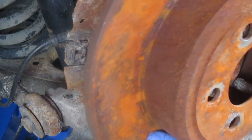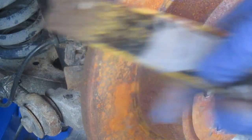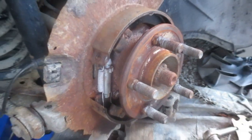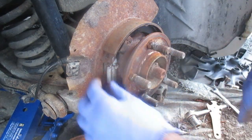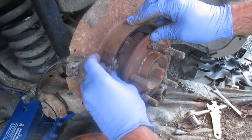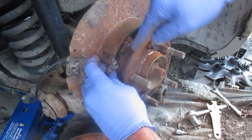What I had to do with this car is the previous owner had left the emergency brake on and those pads were right into it — I really couldn't get the rotor off. That's a miserable place to work, so I just used a bar because I knew all of these parts were going to be worn out anyway. That is an option, but ideally you'll be able to release your adjuster by turning it as I showed. Looking at it from the top, you can see that it's getting shorter and shorter, and turning that wheel counterclockwise will let the brake shoes come in and release.